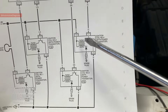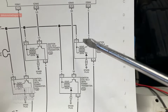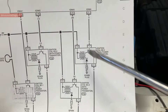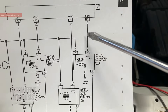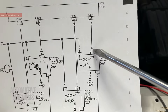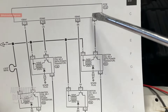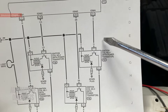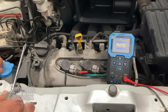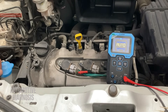That's why the testing procedure on this ignition coil is a little different from the two-wire coils. In this case we can check the positive, we can check the negative, and for the trigger wire we can check it with the oscilloscope. Of course we can also check this wire with a multimeter for open circuit or short circuit between the ignition coil and ECM, but the best testing procedure is to check the trigger signal with the oscilloscope.